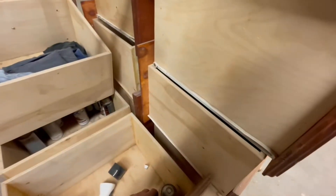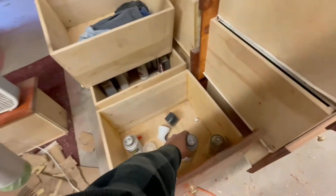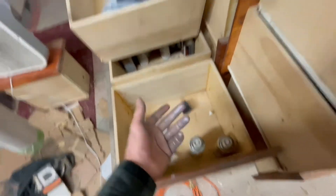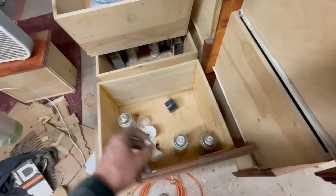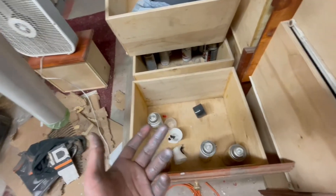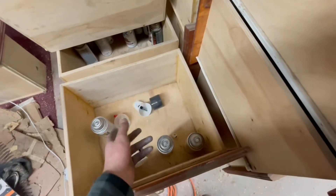This is one of the worst products I've ever used. I've painted a lot of things — I'm not a professional and I'm using a rattle can — but two cans had the spray heads stop working. I pulled them off and tried a standard Rust-Oleum tip, but the straw in this can is a little wider than a standard one, so it just started spraying everywhere. The stuff is also super thin and very transparent, so it's probably going to need three coats, and one can only did one coat.